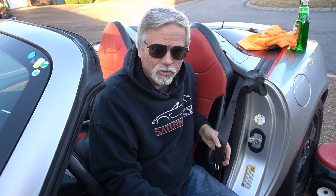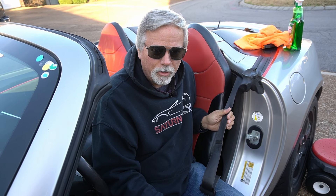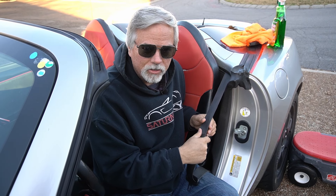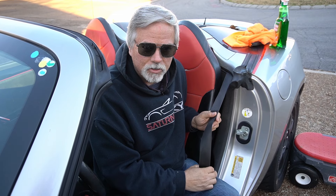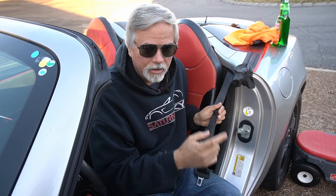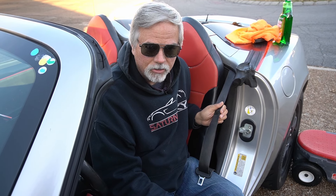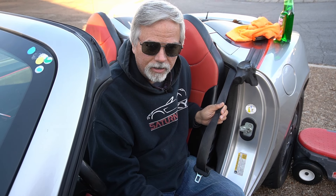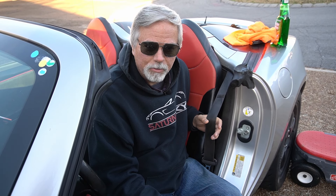So there you go, that seemed to work. Like I said, there are two ways you can do it: stretch it out and put it in a hot soapy bucket of water for a while, or take an all-purpose cleaner and clean it the best you can. Try the easy way first, and if that doesn't work try the bucket of water, and if that still doesn't work it might be something wrong with the retractable piece in the back that you'd have to replace. Since this worked, I'm going to go ahead and do the passenger side too.